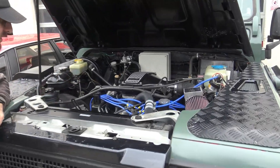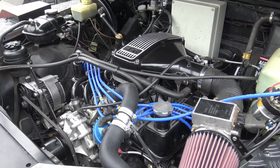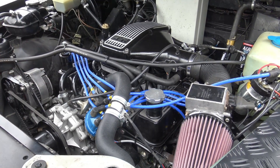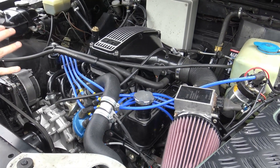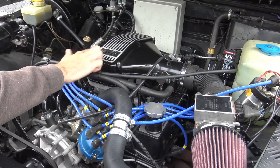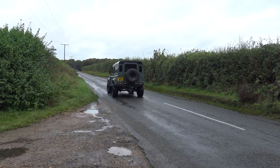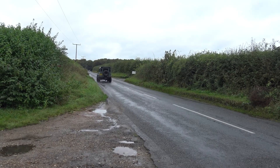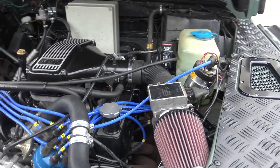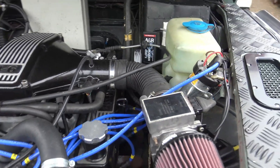Under the bonnet then, it's business as usual. We've seen lots of these with fuel-injected engines in. It came in as a 3.9 fuel-injected vehicle. The injection system and ancillaries have all been removed from that engine and completely cleaned down, done in our normal kind of paint scheme. The 3.9 emblem that's normally cast in there has been ground out and a 4.6 stainless badge put in. The engine specs: 4.6 Stage 3 heads, 270 camshaft, all planted underneath the original kind of outfit. Our ignition upgrades on top, the power amp sat over there on the heater matrix, and obviously a remapped ECU.